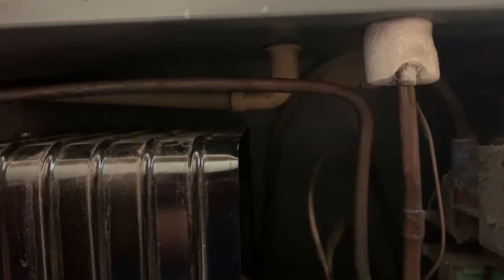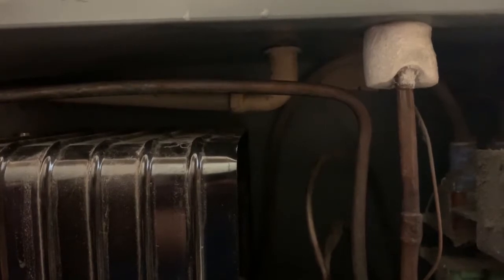So I took off the back panel inside the back of the freezer, spent a few days cleaning out the ice from there, as well as flushing it with some hot water and baking soda, and I noticed that the problem persisted.